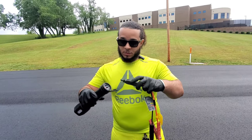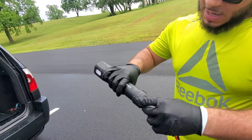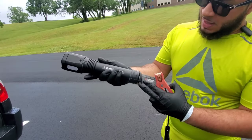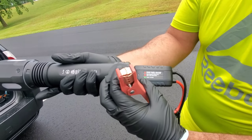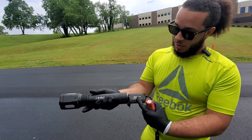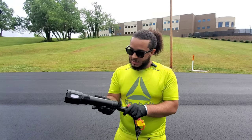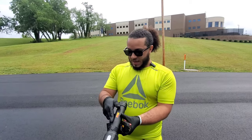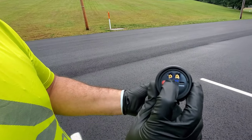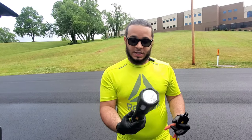When you want to plug your alligator ports into this device, you simply push it in like that. Once you hook these alligator clamps to your battery, you'll notice that this little LED indicator light here will turn green, meaning it's ready to start and ready to jump your car. It also gives you other things to look out for if it were to blink or stay a steady red. It also shows you right here how much battery life it has in it.